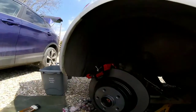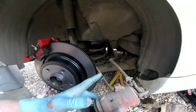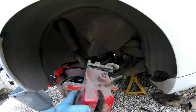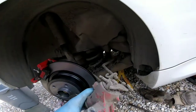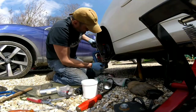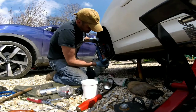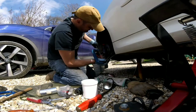I can't find a proper paste so I'm just going to put a copper slip on for now, which is a pain. I clamp that because when I wind it back in, I let all the fluid out of the brake nipple — it says it's going all the way back through the system, backwards through the seals. I'll get a good clean first. I've got a G-clamp which turns it clockwise, and as I turn it clockwise it depresses it and winds it back in. The brake fluid comes out at the same time.